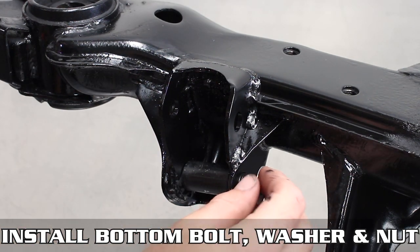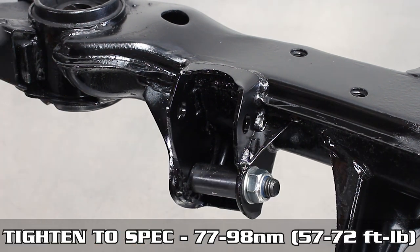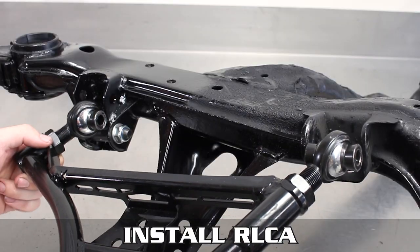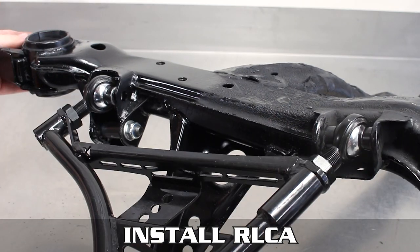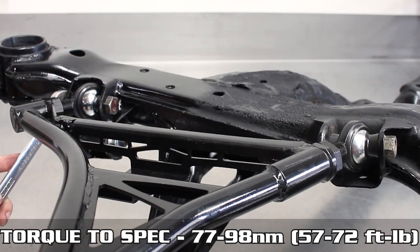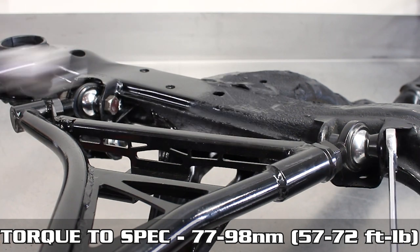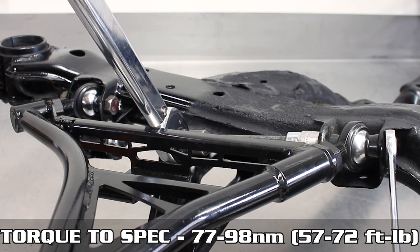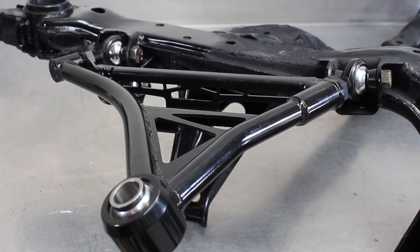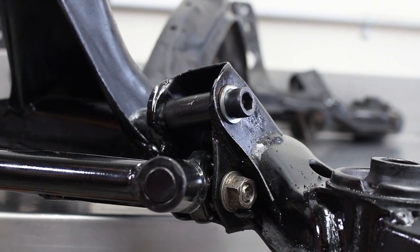Now for the final time, install the bottom bolt, nut, washer, and insert using the other insert for the opposite side, then tighten it all down and torque to the settings shown on the screen. Now reinstall the RLCA using all the appropriate hardware, torquing to the specs shown. You now have a grip-appropriate subframe to get those God-tier drag launches down pat, just like your S14 and S15 brethren. Do leave that insert in, as it adds strength to the bracket.